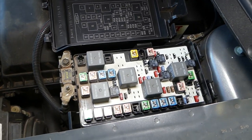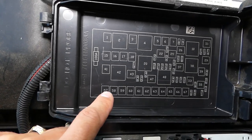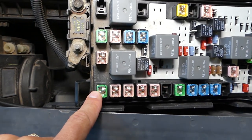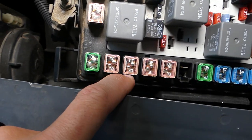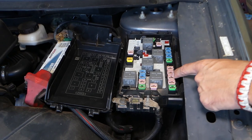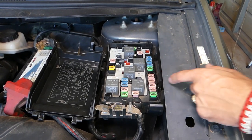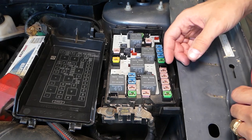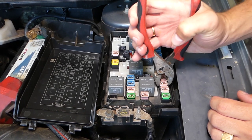The cover shows just the fuse numbers themselves. The first fuse we need to check is fuse number 59. Fuse number 59 is the third fuse on the bottom right here, from left to right: one, two, three. It's a 30-amp fuse. Usually you can tell if those are burnt or not by looking at the screen — if it's burnt, it will be kind of black and missing a little bit of the element. If you need to buy a replacement, we'll have them listed in the description of the video below.